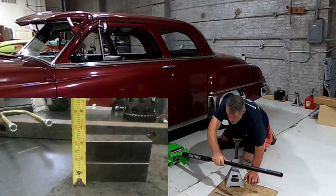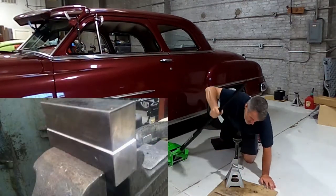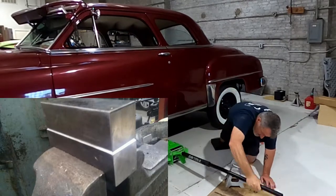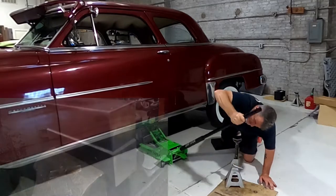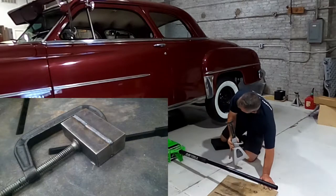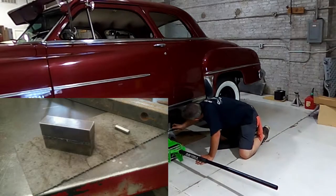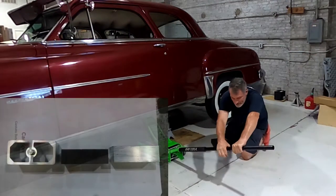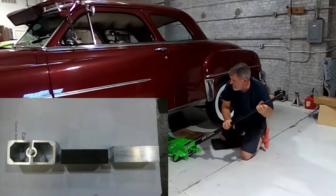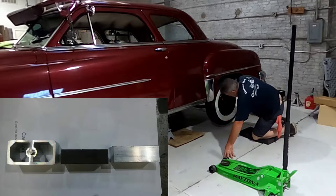Two pieces are cut and stacked — those need to be welded. To get a three-inch drop I beveled the edges on the top of one and the bottom of the other so the weld can penetrate and be roughly flush, then clamped them together. My buddy Steve of the Decent Boys — Decent Steve — is pretty good at welding, better than I am, so he TIG welded the two pieces.